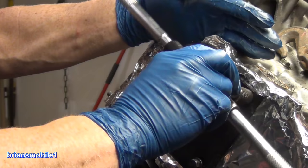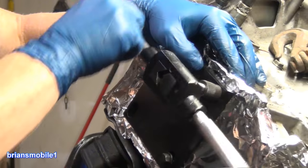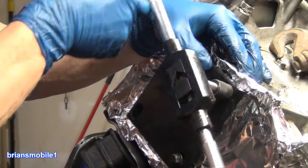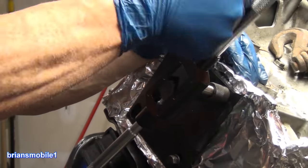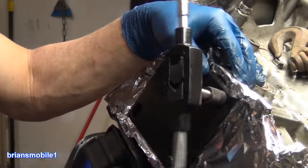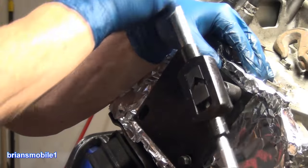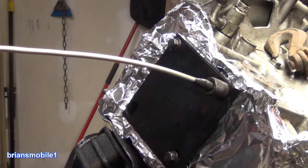All right, so this is in there. We get in there and give it a good start. Make sure that it takes and has some traction before you get crazy with it. Ever see these driven by a drill press and they just go for it? You want to take at least two passes here. These have some pretty big flutes so that it can catch the chips, but don't tickle the dragon's tail too much, right? All right, we are clean and clear.